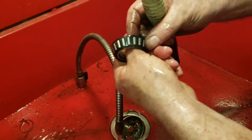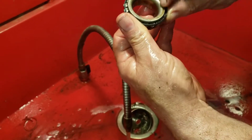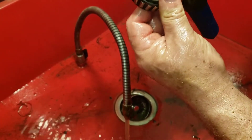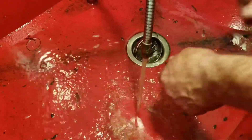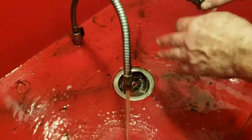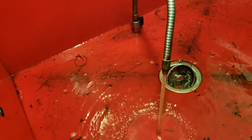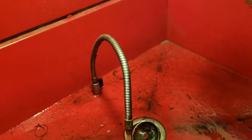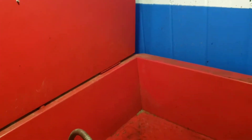Give it a shake, give it a roll. Look on the inside — there's always a number on the bearing. It's a little tough to read because this bearing is on the outer edge and has some tarnishing. When you replace the bearing, you always replace the bearing and the race — not just the bearing. Always put a new race on it too. Nice and clean.